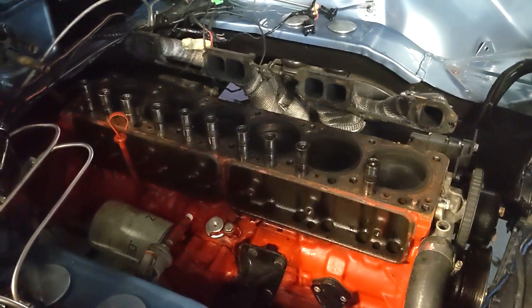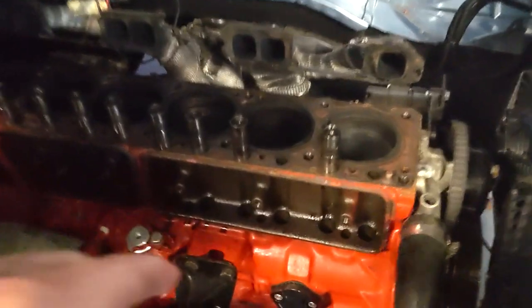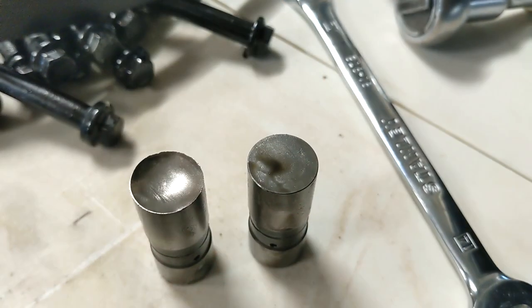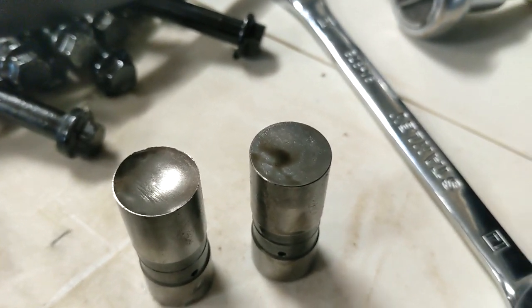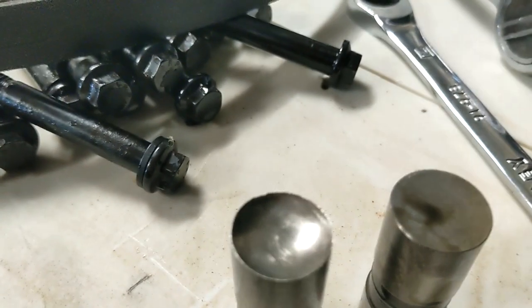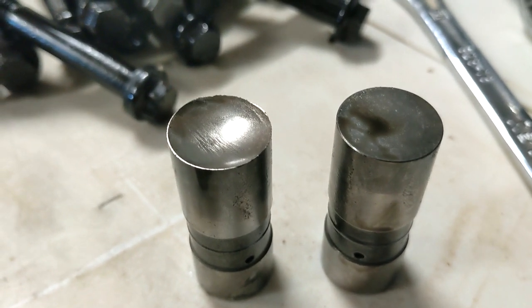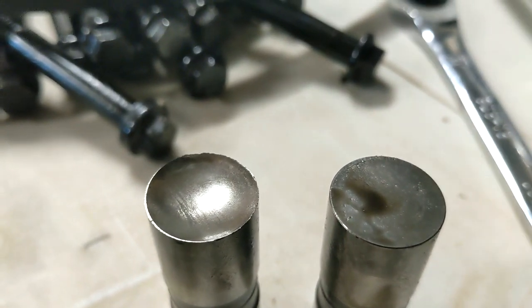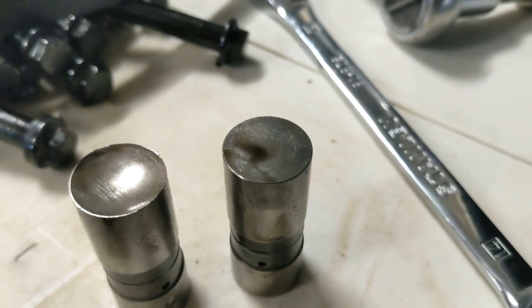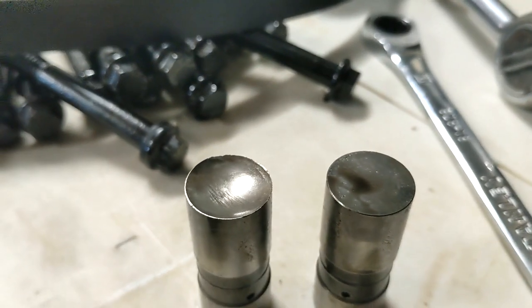All the hydraulic lifters are sitting lined up there except for one — there's a little gap. The third one in had a lot of trouble getting it out. That lifter has one tap in the motor. What's going on with this lifter and that lobe on the cam, I do not know, but it has worn the hell out of that lifter. Whether it seized at some time or lost its oil pressure, who knows what happened. But at least I've got an answer to that question — that lifter is absolutely knackered. That's the tick in the motor.